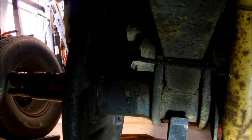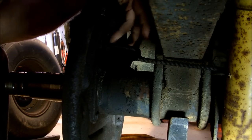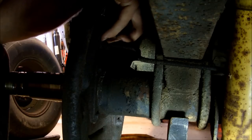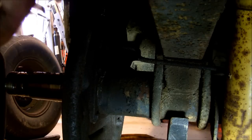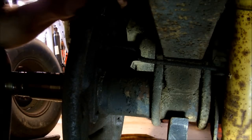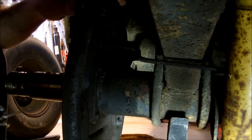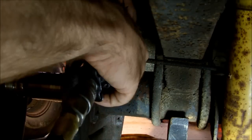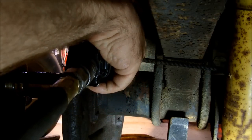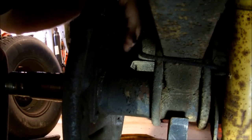I'm about to take the wheel cylinder off. It's kind of hard to see without getting the camera in here, but here's the brake line, which you can obviously see. And there's two 3/8 bolts. Now, I already did the other side, due to the magic of Hollywood here. And these nuts are not coming out, period, which I was kind of prepared for. So I'm just going to go ahead and cut the line right away with this little air saw. There you go. And the line's off.